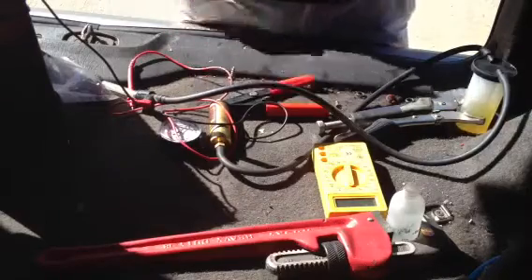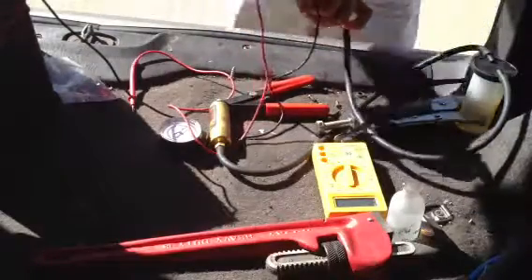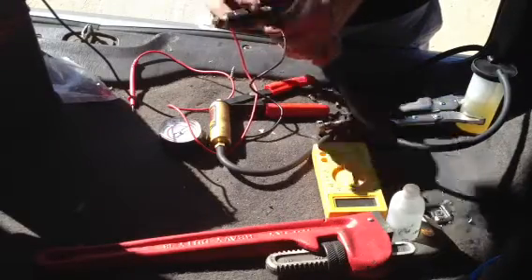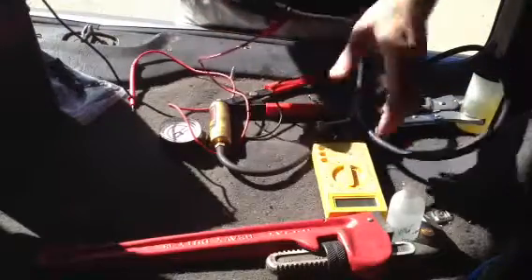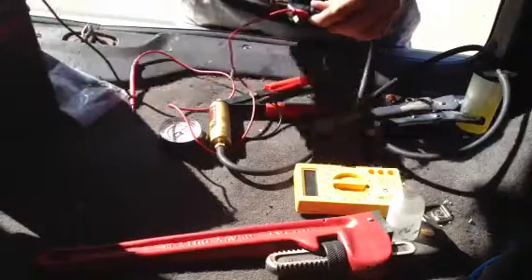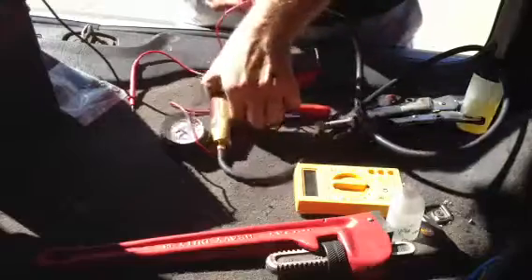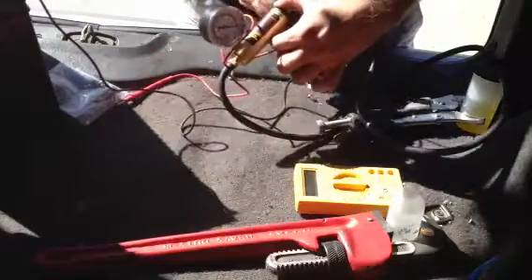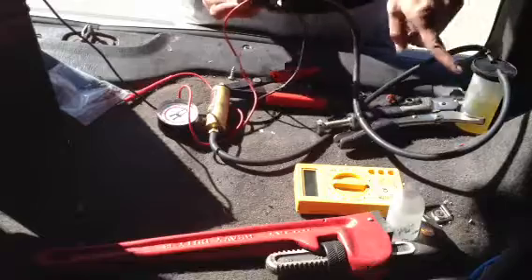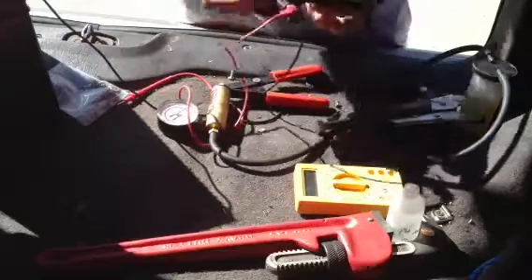This is the mechanism I have set up. The fuel injector, taken right here, starts out like this. I went ahead and popped off the pintle cap and the rubber grommets on both sides. I took voltmeter leads and plugged them into the actual metal terminals for the fuel injector. Then I took this vacuum pump system from Harbor Freight, hooked up the tube from here going into the catch can, with a lead going down into the bottom of the tube and hooking into the fuel injector.